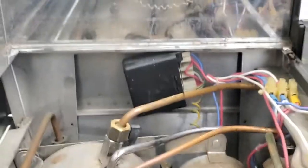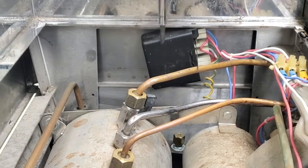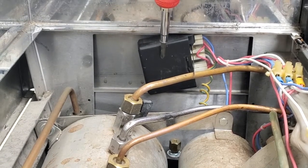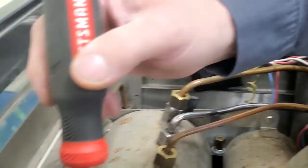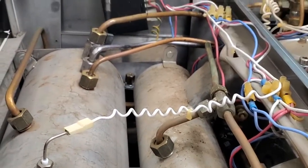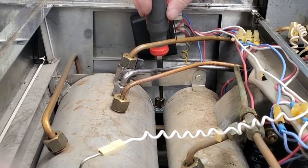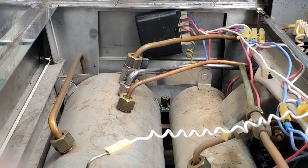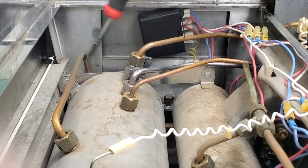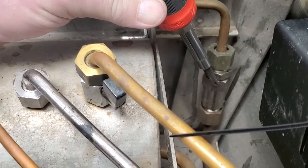This particular unit is semi-automatic, so the only electronic box we have is our liquid level control box. Here's our fill probe that goes to that, and what it controls is it opens up a fill valve down below and turns the pump on. Here is our fill tube and it has a check valve in-line on this side.